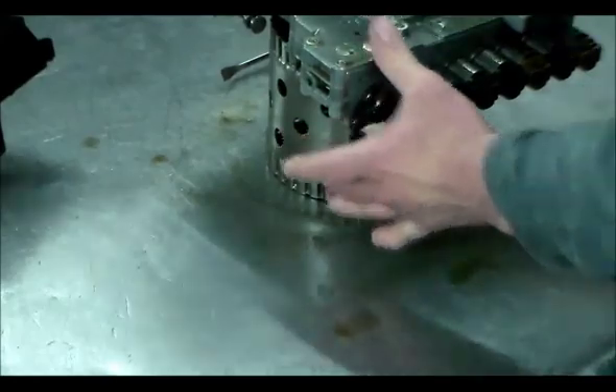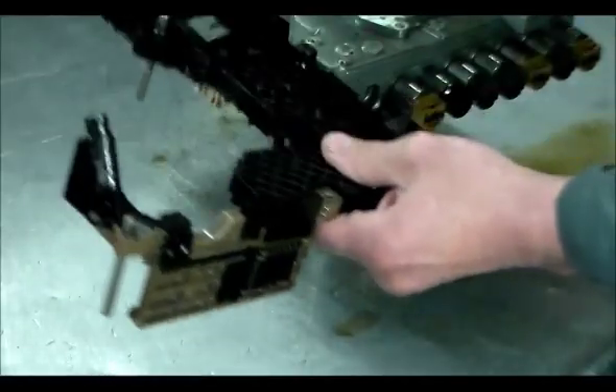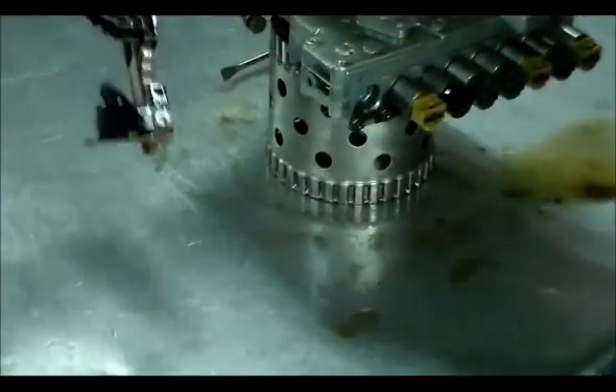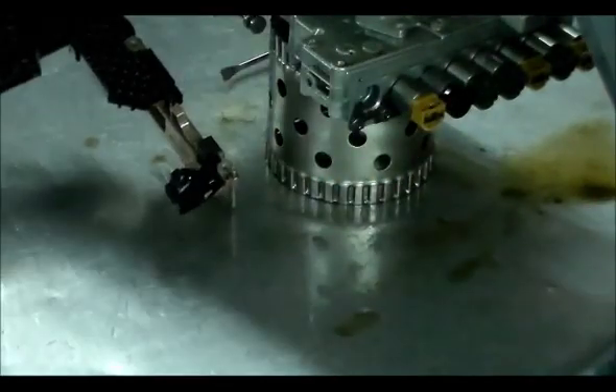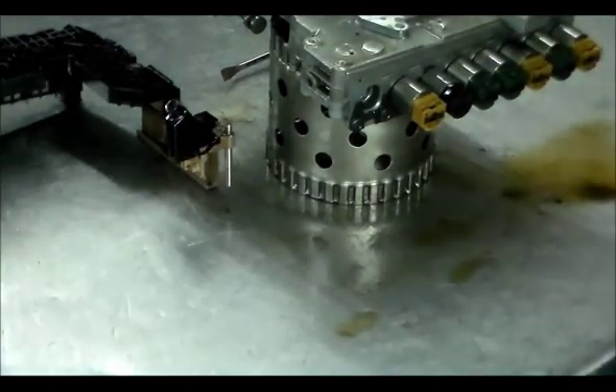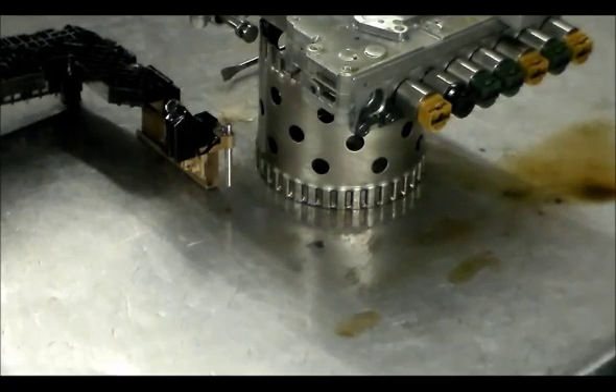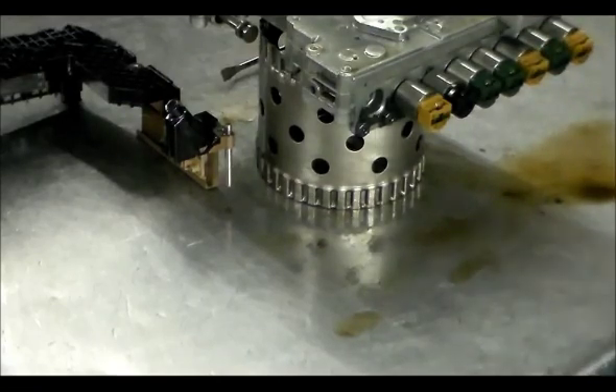While I have this thing apart, I'm just going to do the typical cleaning of this plate here — get all this debris out of it, because there are magnets in here and these are the metal filings that attract to the magnets. I just want to confirm we are going to fix this. It's easiest to just drop this out and test. The owner of the shop said he wasn't sure what he wants to do depending on the problem, so I'm going to call him and give him the price for installing the solenoid kit, reinstalling the original pan with new fluid — the Lifeguard 6 — and go from there.